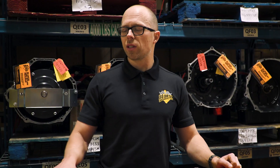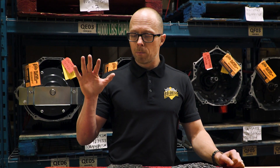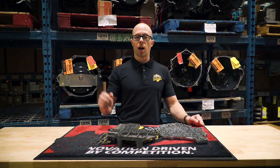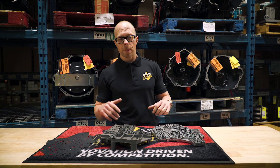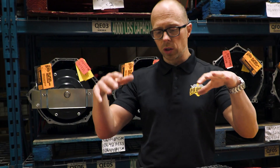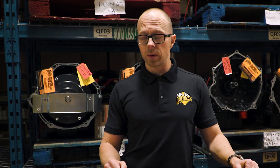The way we discovered this was not through a valve body tester — it was actually by bolting a test unit inside of a transmission and taking it for a drive. This unit had roughly a thousand foot-pounds of torque, and as you would expect, the entire transmission distorted, twisted and turned, and it developed cross leaks that weren't apparent on the valve body tester that we have.